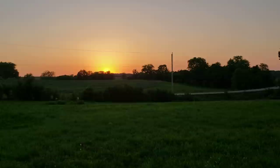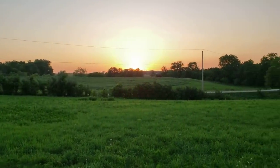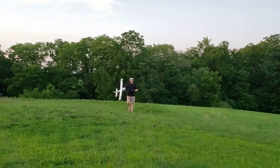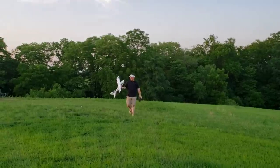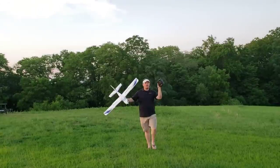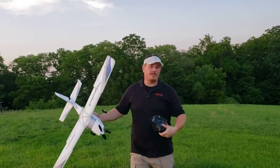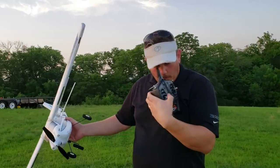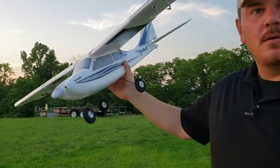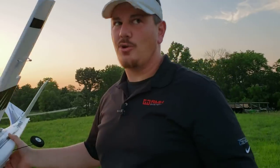Okay, I'll be right back. Yeah, well, no, I would just probably pause it. So, everything looks good here. No damage, obviously. And once your low voltage warning kicks in, the low voltage cutoff is gonna stop you from using the throttle. Whoops, I lied. My throttle cut was on. That's what low voltage cutoff looks like. Throttle cut is on, don't forget to turn that on.